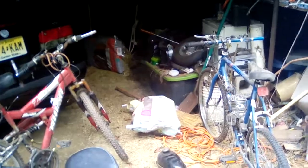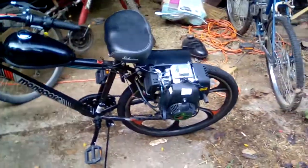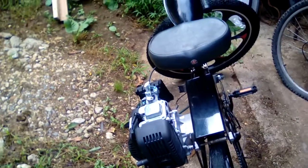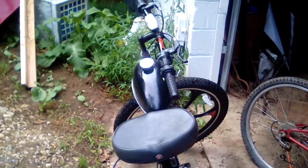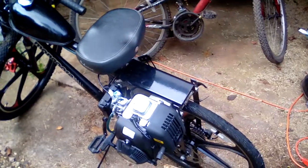Those are the two basic kinds and they do work great. Like I said, the top speed I ever got on that one was like 24. I don't think I ever got over 15 on the chain driven one just because it was so finicky and the chain was always throwing. This one I've gotten downhill up to 35 miles an hour. And even in wet weather, I put a lot of tension on that back tire because I like having the extra power. If you put a little less tension, you might get a little bit more out of the top end, but you'd really have to feather the accelerator because otherwise it'll slip too much. So I like it with a lot of tension on it.